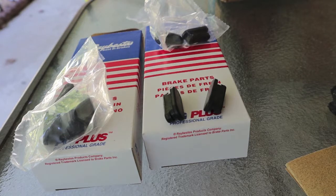Dexter made a decision. That's fine. I like Dexter axles. I like the Easy Lube system on them. I don't know about the auto adjust brakes or the self adjust brakes. I don't know how good that's going to be. I don't like the fact that my trailer brake control is maxed out on 10.0. I can't go any higher, and it's still not where it needs to be.